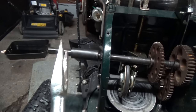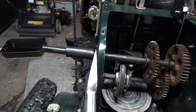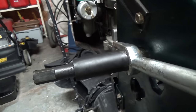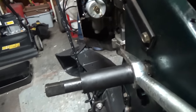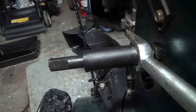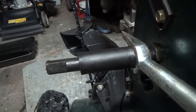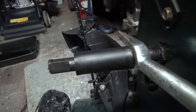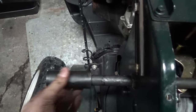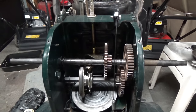I'm using what I call a tie rod removal tool — it lets me go in behind over top of the axle and apply light pressure to the back of that spacer. This is a very slow process; I'm not trying to damage anything, just applying a little pressure to that spacer until it starts to come off easier. Now I should be able to pull it off by hand — and sure enough, it slides right off.